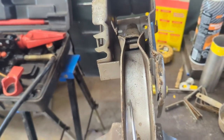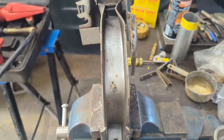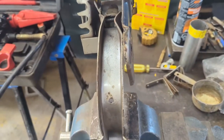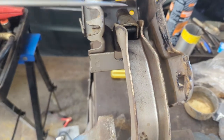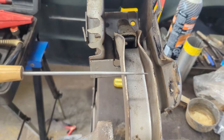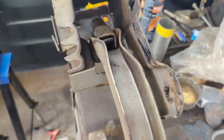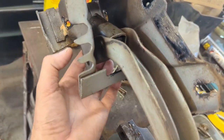The plan is: I'm going to spread that back out with my porta-power, get the little jaws in there. Then I'm going to cap this along here with a piece of 16-gauge steel, as far as I can get without interfering with this piece — because this is the piece that goes in the torsion loop, the loopy part of the torsion rod.